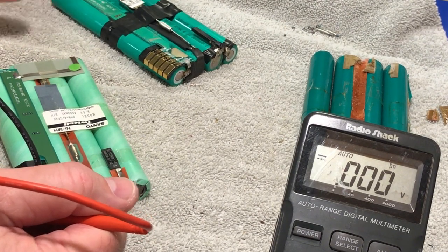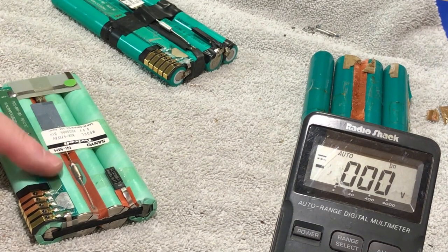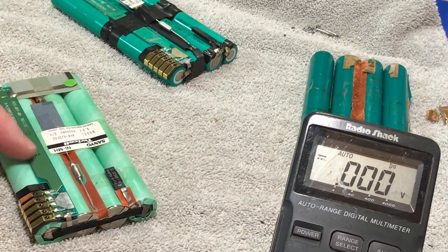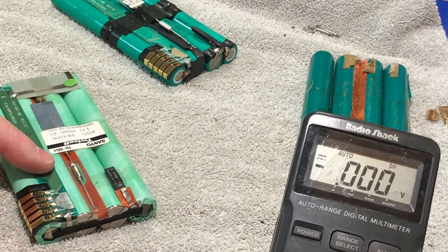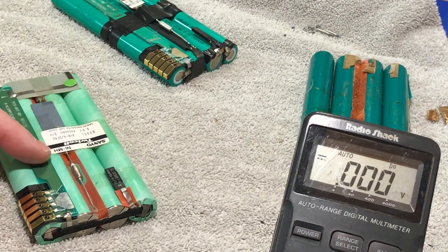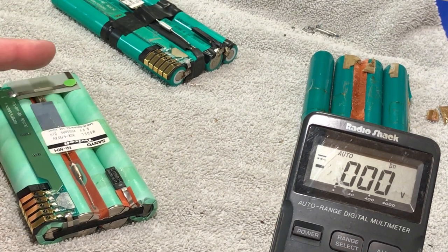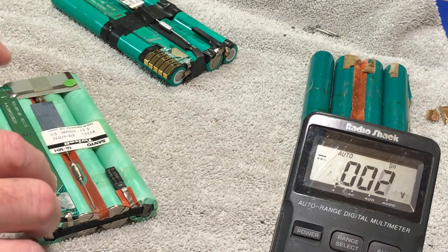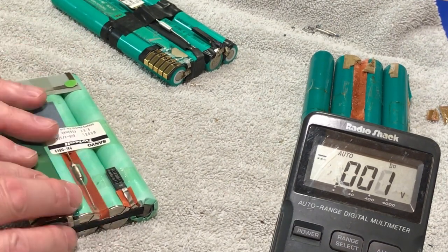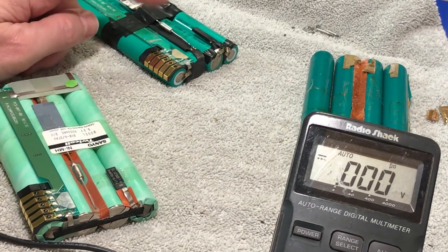So I'm wondering — my next thought is about the board. There was a comment asking what's on the underside of the board. When I pulled it out there's some hot glue on the bottom side holding it down, and there's a tiny little component that looks like a cap, and then what I think is a transistor or a diode — probably a transistor. Maybe that's why I'm getting full power on all those terminals — maybe that transistor is not switching. I have to verify that's what it is. I'm wondering if I take this board off and put the other one on, if it'll work, and if it does it tells me there's a bad component on this board.